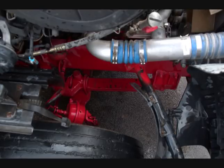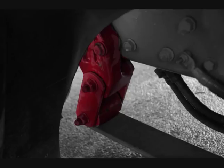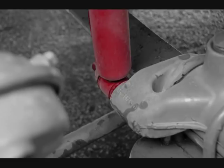Check the left front axle. Check the leaf springs for any missing, shifted, cracked, or broken leaves. Check the spring mounts to make sure they are not broken or cracked, and make sure there are no missing or damaged bushings. Check the U-bolts to make sure they are not broken, loose, or missing any nuts or other parts. Check the shock absorber to make sure it is secure and not damaged or leaking. There should be no cracked or loose rubber bushings.